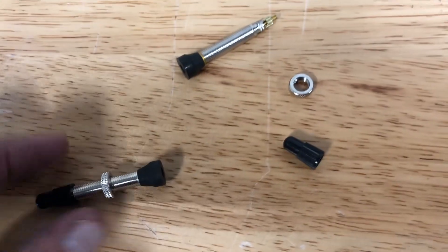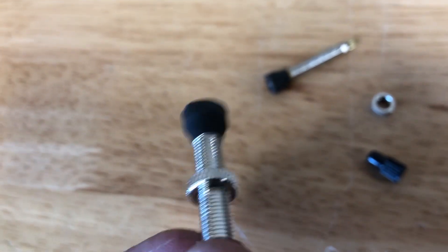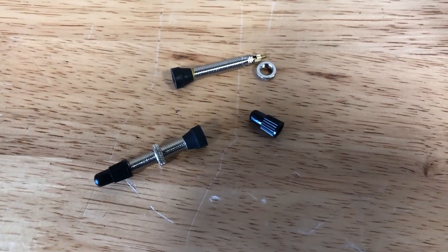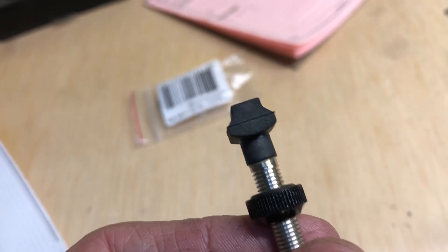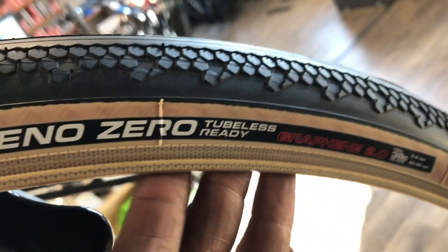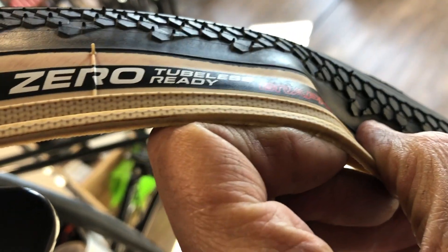This particular wheel had an inner tube, regular tire, and a tubeless ready tire. As far as the valve stems you're going to use, probably around 90% of the time I'll just use these little Stan's valves — it's kind of got a little rubber cone shape. I suspected on this rim, cause it's got a U-groove shape there, I might have to use the other valve. But the most important thing is to have all tubeless-ready components.